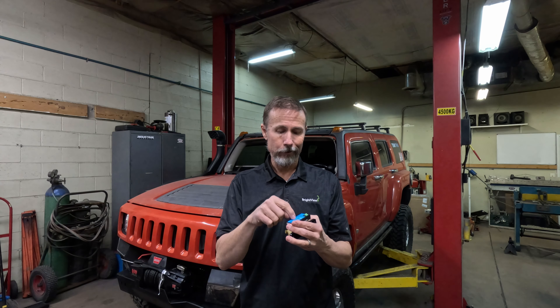Underneath the rear right above the axle, there's going to be a 135 amp-hour Dakota Lithium battery to run a freezer in the back and a couple of other accessories. For that, we bought a Victron battery monitor — it's wireless, so you just use the app on your phone to check charging status and how much battery you have left. A lot of lithium batteries don't have a built-in app, and we wanted something really simple. This is going to do the trick.